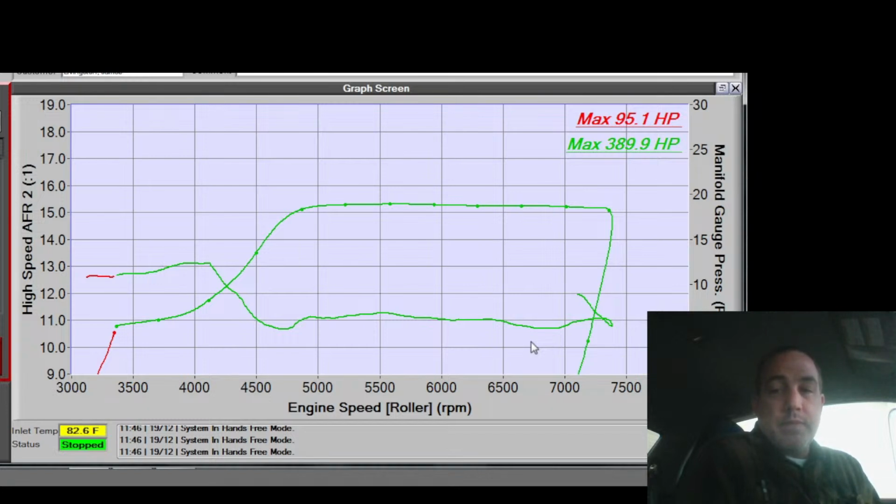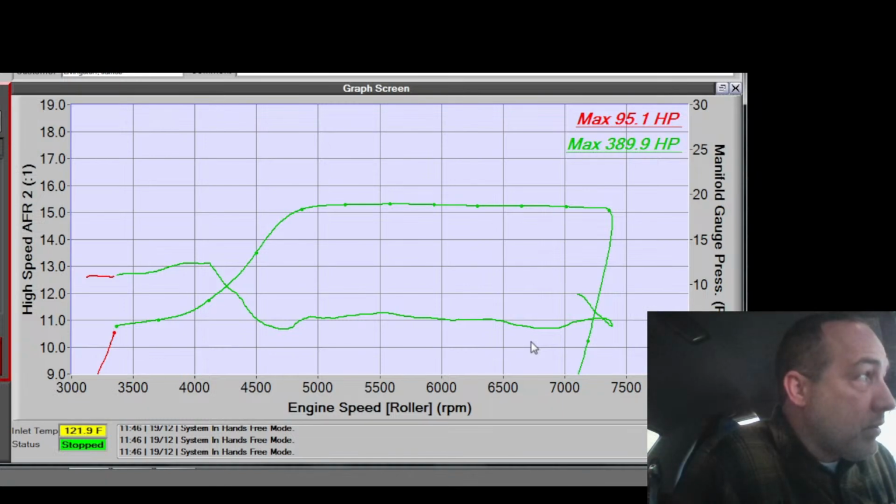Number 2 is a cooling mod. But number 1 is definitely give the ECU the correct charge temperature so that it can give the engine the correct timing. Unfortunately, with these top mounts, the intake air temp is in the MAF, right? So the ECU goes, oh, look at that, we're at 80 degrees. Well, you're at 80 degrees because you were sitting at the light and the whole thing soaked to 150, 200, and then you start to accelerate and immediately it pushes cold air into the intake. The MAF sees 80 degrees and tells the ECU it's 80 degrees, but that intercooler is still 200 freaking degrees. So you end up having 200 degree charge temps with 80 degree indicated temps, and shit goes poof.